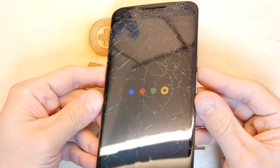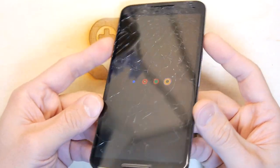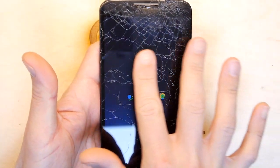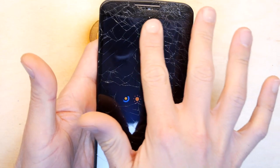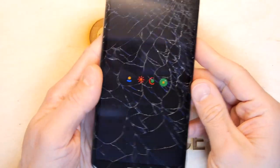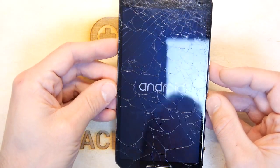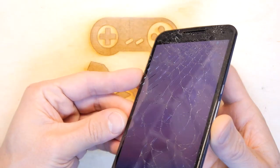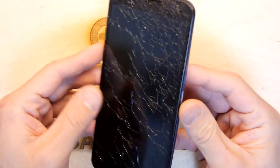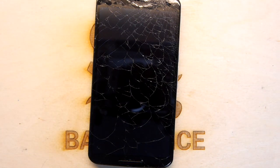It's had its time to cure now and you can see it actually came up pretty well. It's a decent shine. Now I have to say it didn't draw into the cracks as much as I had hoped — it didn't really capillary in and fill those up obviously — but what I do notice when I rub my finger on it, it's actually really smooth. It's not got that sharp cutty feel. I mean you're still going to probably wear away your fingertip using this, but it might just be a viable option if you're stuck and just need your phone to be semi-salvaged to get you to the end of the month till payday. I'm waiting for my screen to come in the post and when it does I'm going to attempt to get this off and fix it — we've tried these Nexus 6s before and they've been a little bit tricky. Hope that's been of some use to you. Please like, comment and subscribe, and thank you for watching.